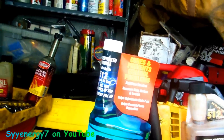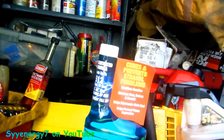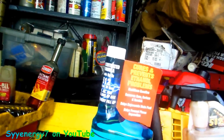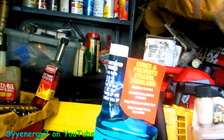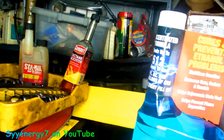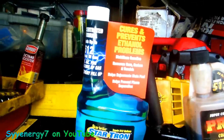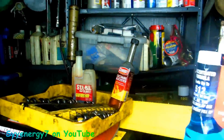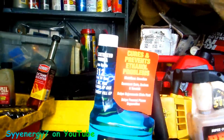If you do that YouTube thing where you take E10 gas and separate the ethanol out and pour off the real gas — first off, it costs you more money because the 10% ethanol is just a cleaning agent you might not find much use for. Then you're lowering the octane and you'll have to pay for an octane booster, plus all that work. This is cheaper. The Startron is a great product. The new Stable 360 Marine is a great product. But they're limited.